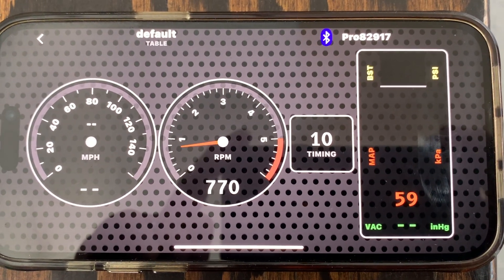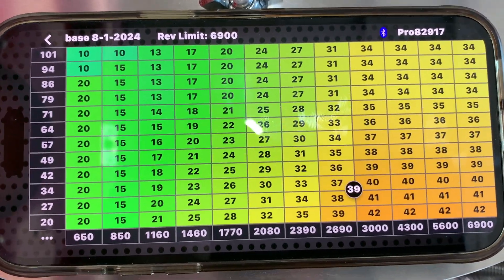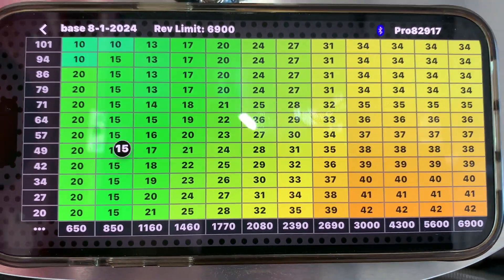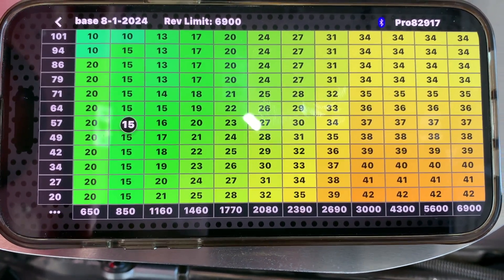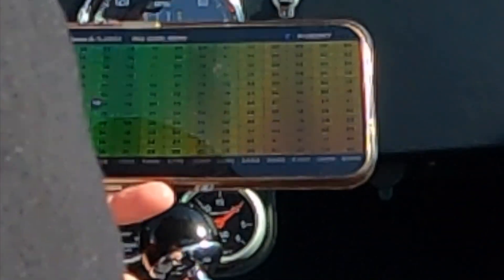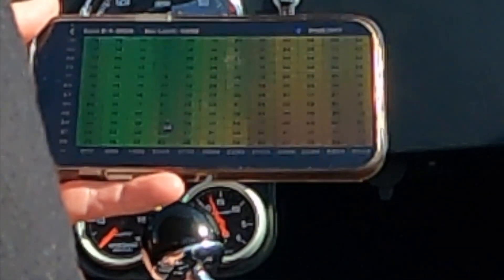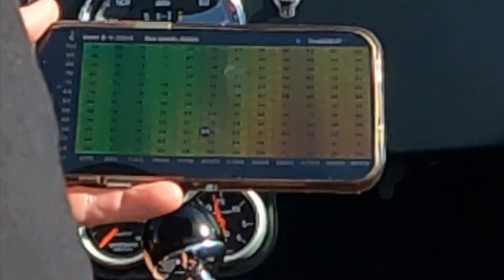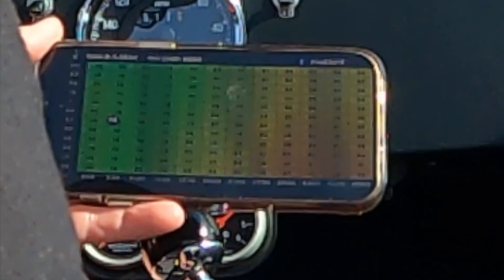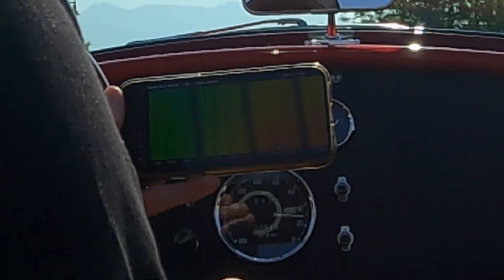In the app, there's also a spot where you have gauges. I haven't tried the speedometer yet — I haven't been outdoors with it — but it's a GPS speedometer. Here's the active chart. That black bubble you see moving around is the actual timing that's happening. It's a combination of the RPM, the curve you put in, and the load of the engine. So here you have the live table in the car running. The black bubble moves around on there — that's where the actual timing is. All of those numbers in there are the targets you put in on the table you build, and it's making all those adjustments between the table, engine RPM, and engine load. It's pretty slick.